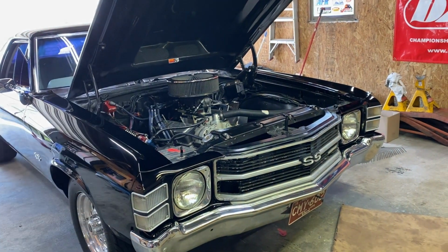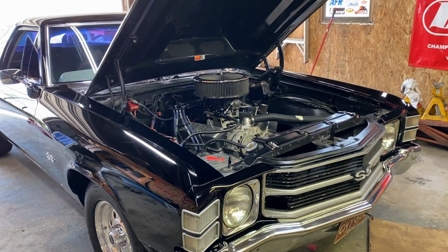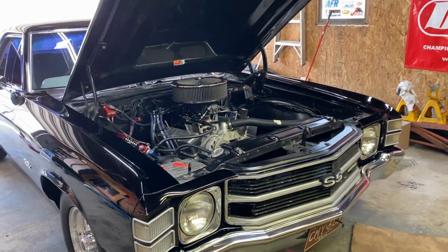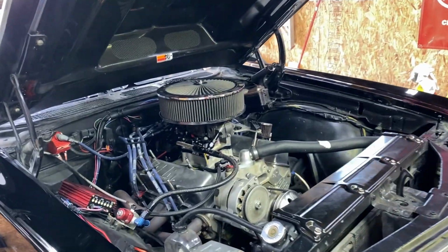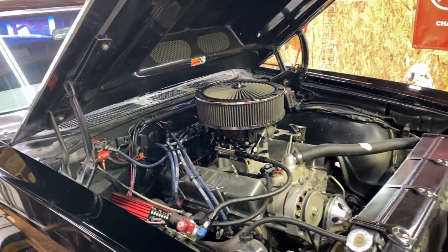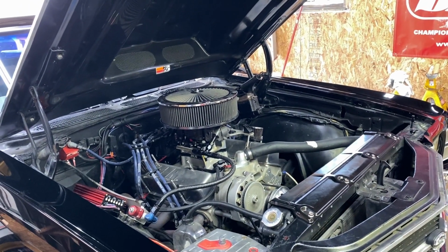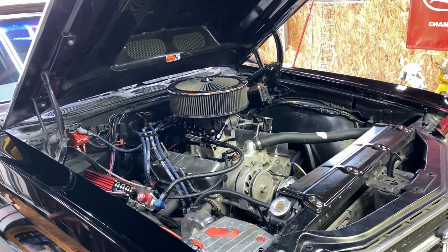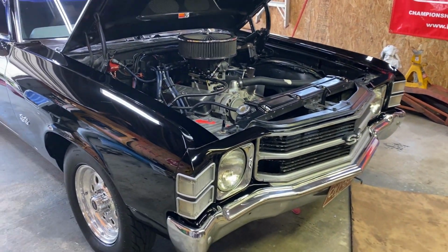I'm actually going to jump up on the power valve, go up a couple numbers on the power valve, and I'm thinking about taking the rear power valve out and going up 6 jet sizes on the rear and adding 2 numbers to the front power valve, and we're going to go from there. But other than that, man, this thing ran great going down the road.